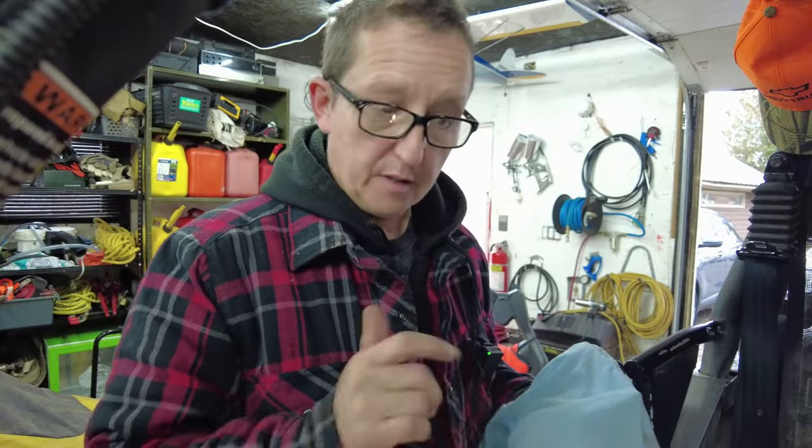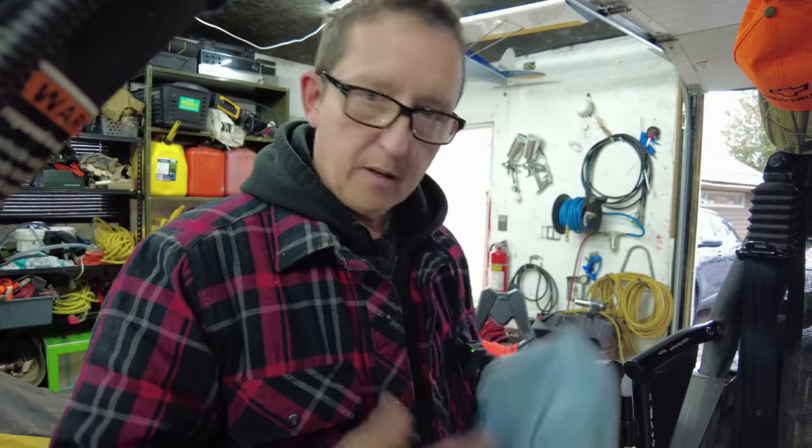Alright friends, so guess what? I've heated it up until the actual cooling fan comes on, and you just saw me check the oil filter housing for leaks. No leaks there. Underneath is nice and dry. The plug's nice and dry. So I'm confident now that it's been up to operating temperature. You can hear it ticking away, I'm sure, that we are good.